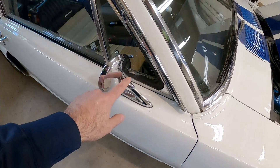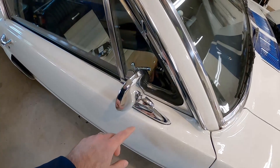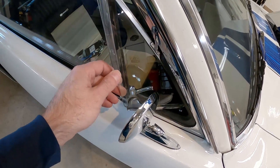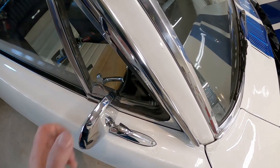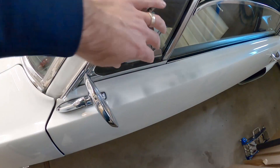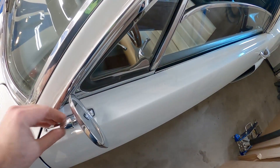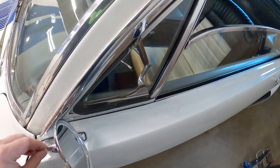What's up guys, my name is Andy. In this video I'm gonna fix the location of the mirrors on my '66 Mustang. I don't know who put these mirrors in this location, but this is not the right location. On the passenger side, not all cars came with the mirror, but this is not where this one goes. If you open up the vent window here, it hits this mirror and you can't even open it all the way. The mirror on the driver's side is even worse — it's way up near the front of the door. I have to almost look through the window to see the mirror, so it needs to be moved way up, and the passenger side needs to be moved up too. Let's get started and get these things moved into the right position.